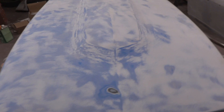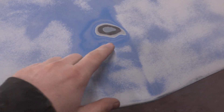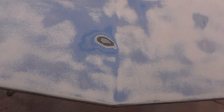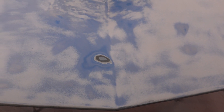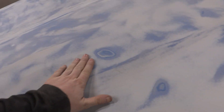The hood was pretty smooth to begin with so it wasn't too much work to get it smoothed out. I did have a scratch right here that's pretty deep - I kept sanding into it and you can see there are like ten to twelve layers of paint. I finally got to the bottom of the scratch, but by doing that I made a low spot. So if you're at home and you see a little scratch, I think just coat that with body filler and sand over it rather than do what I did - because now I've got to cover this whole area with body filler. I'm gonna mix up a little bit of body filler and spread it over this area to match the surface around it, then give it a quick sand over and that'll flatten everything out. Other than that everything's looking really good on this hood - no weird low spots. I'm gonna mix up some body filler right now and get that done.